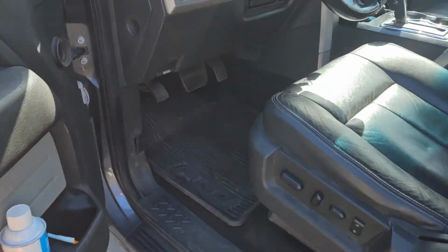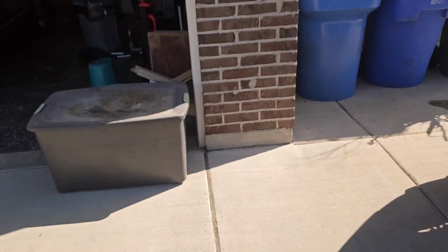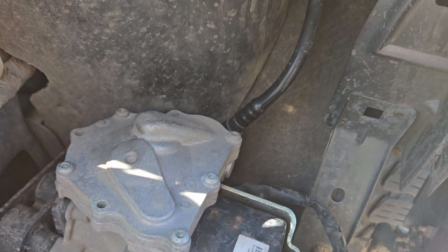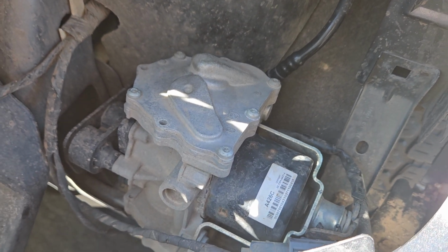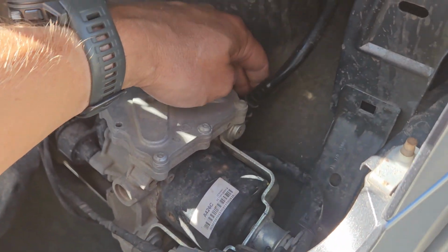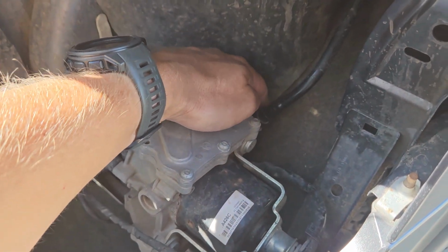If you need to get it to run again, just come in while it's running, give it probably 4 or 5 presses, and you should be able to get it up and running again, enough to get that silicone to distribute down in there and lubricate those seals and those bearings and hopefully shut it up for a bit. So again, it's really not that bad to get this thing out to do this. There's a couple guys that say every couple of years they now just have to pull this, spray in again, get some stuff in there.